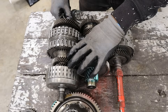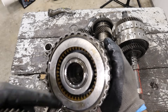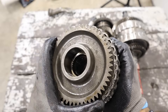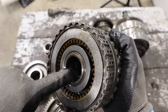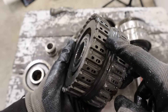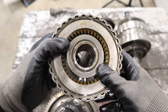I'm going to take this apart to take a quick look at how the clutch setup works. Looking inside a clutch pack you can see these yellowish teeth — that's the friction material that sits inside of there and latches onto these inside teeth on the gear itself. You can see how that's going to freewheel on the shaft. On the inside here we have this collar that has teeth, and that's actually splined to the housing. If you look closely inside you'll see little holes — that's going to send hydraulic pressure to lock up the outside here with these inside teeth.